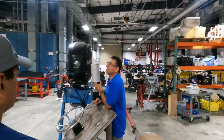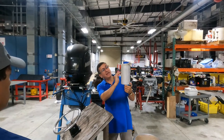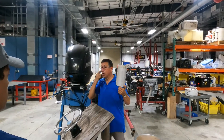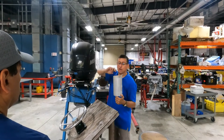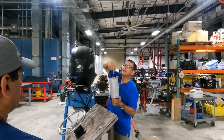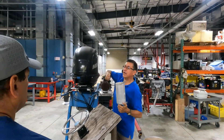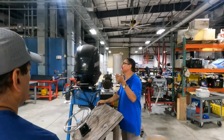What is this? The reservoir. With the reservoir, it's nice because I can see the level of the fluid, I can see the color, I can see if I have bubbles. And on top, I have a fitting. I remove the fitting, I add more fluid, I put back the fitting, and with a bicycle pump I pressurize the system.